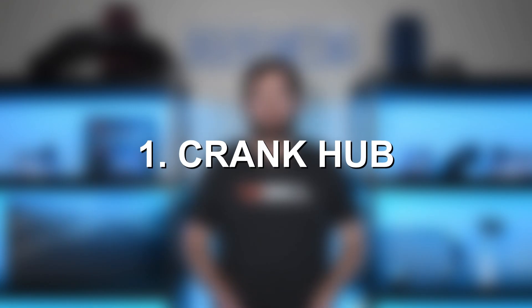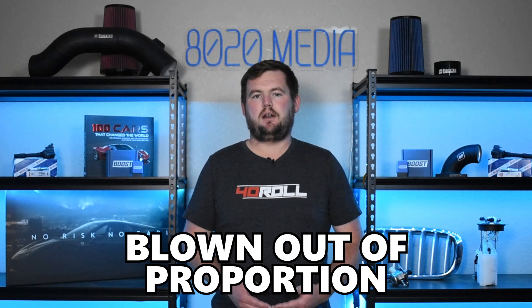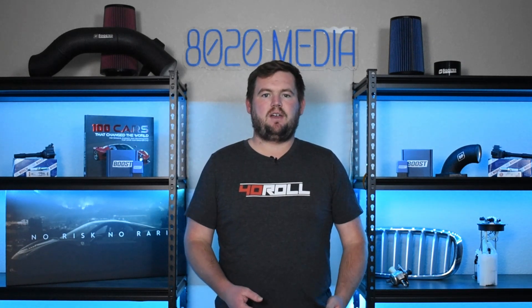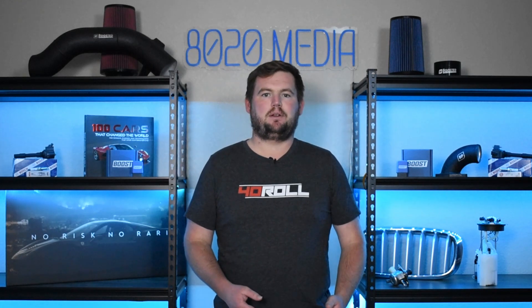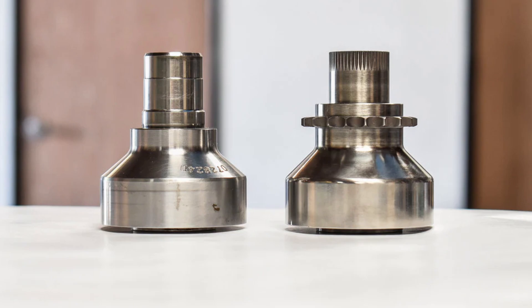Number one on the list, we have the crank hub. I want to point out immediately that the crank hub is an issue that has been largely blown out of proportion on the S55 M engines. There were some failures in the early days, and it led some people to panic and believe that this was a super common and devastating issue for the engine. However, it turns out that crank hub issues — or spun crank hubs in particular — affect a very, very small percentage of these S55 engines. The crank hub design was a little bit antiquated and probably not quite up to the challenge of handling the much quicker revs and higher power of the S55, especially when tuned and modified with the dual clutch transmission.